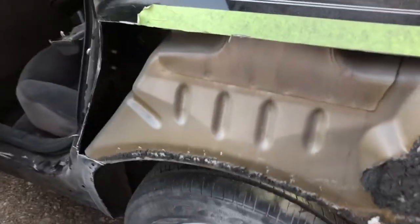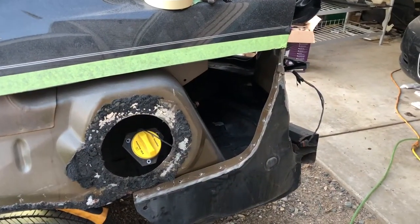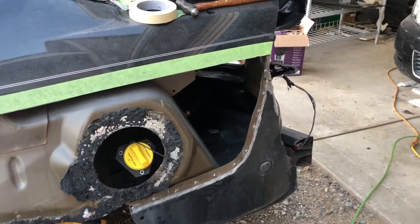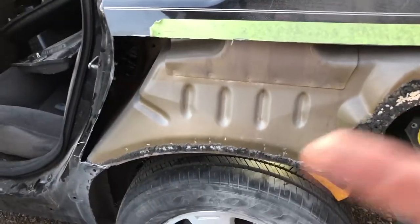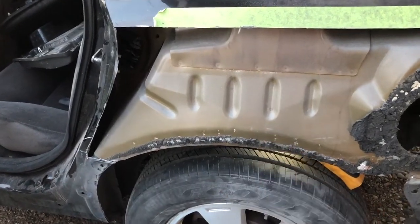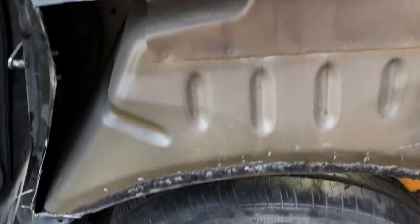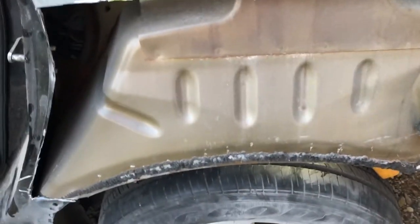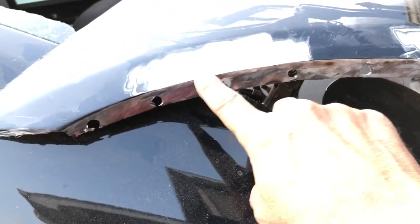Here's what I came up with: I basically ripped off the rest of this quarter panel here. We already took that side of it for the patch on the like side of the car, and I went ahead and cut out the rest of it including the wheel arch. I drilled out the spot welds separating it from this inner panel here, because not only do they have spot welds, they have this goofy adhesive foam adhesive.